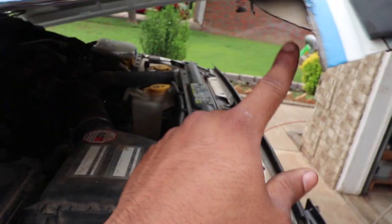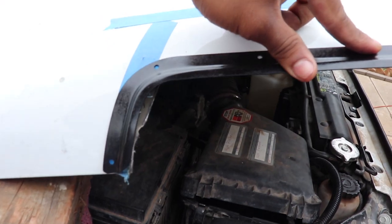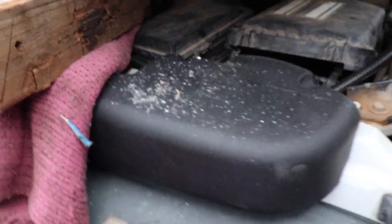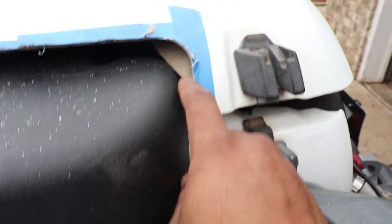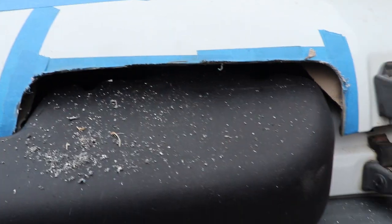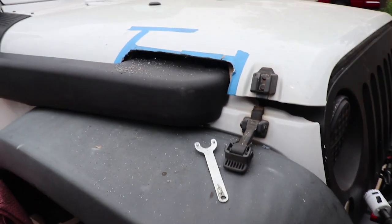This is the piece that came off. As you can see there's a little bit of cleaning up in the corners and I'll probably use the flapper disc and finish it up with some spray paint to prevent rusting. Let me see if the fitment is correct — okay, that looks like it fits over pretty well. Taking out the wood block and dropping it over the actual snorkel itself, yeah it fits over really nicely. I just have to clean up this edge where it's catching, flap it over, and clean it up.